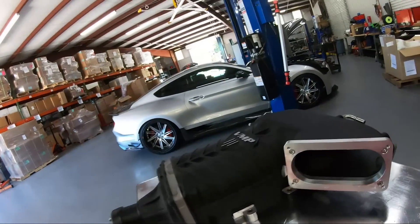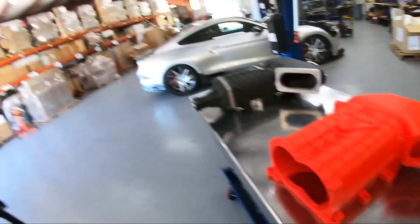Now that the bypass is tucked farther back, you can see this hump comes right up there, and there's really not a whole lot of room for air to squeeze between the bypass valve hump and the rotor bearing cup. The waffle pattern on the supercharger is there for a couple of good reasons — it adds a whole lot of strength to the supercharger casing itself. Inside are the rotors; they spin as high as 25,000 RPM and need a very rigid case. The tighter the clearances are around the rotors, the more power you make, and we've looked at all the clearances in the Gen 3R very carefully — they're optimized for both durability, reliability, and power production.